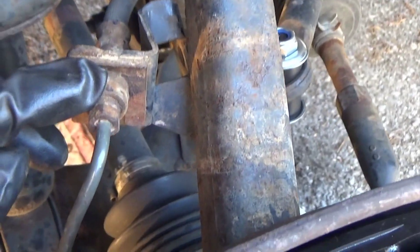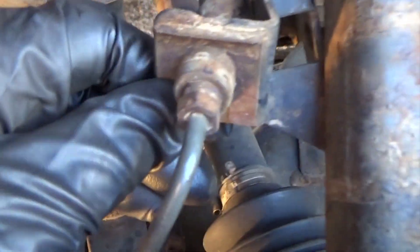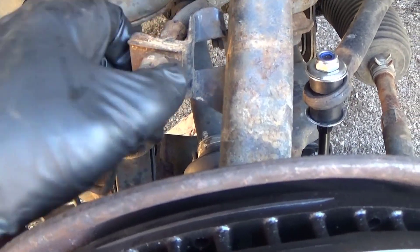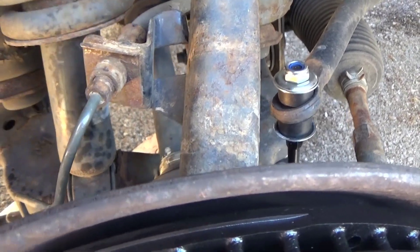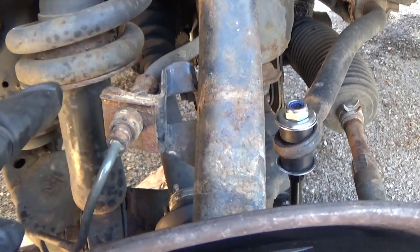You've got to basically put a screwdriver or a pair of pliers. If it's real rusted — like almost all these Toyota Tundras are — you may need to put a little penetrating oil on it if it's really stuck. But you just pull this clip up; it's open at the bottom. You pull the clip up, it allows the hydraulic line to drop in, and then it's free.